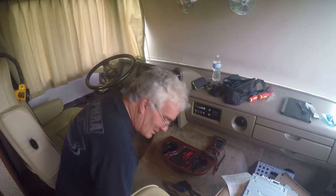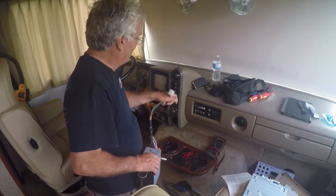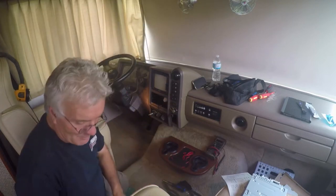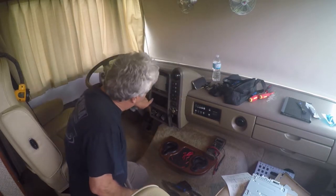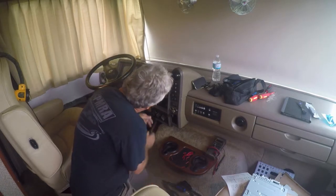There is no adapter made for these. This Molex connector is not a standard GM one — even those units made by GM, it's an oddball. So shove your wires back in. There are little tangs in here which are bent over, and you have to pull them out.